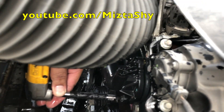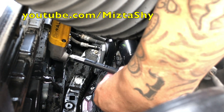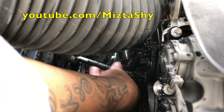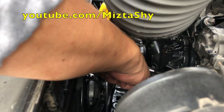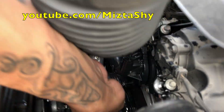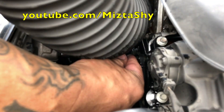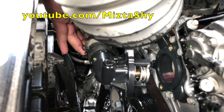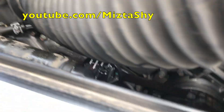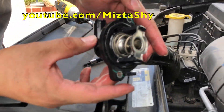It's pretty much just removing this thing and replacing it with a new one. You also need to air it out — you see that little X right there, like a little screw-off Phillips thing right above my hand? For this car, just unscrew that to get all the air out. If you leave an air gap in there, it might eventually release through the reservoir where you put the antifreeze, but if you want to get it done right away, use that bleed valve.